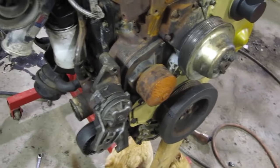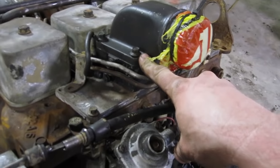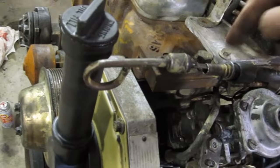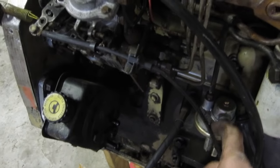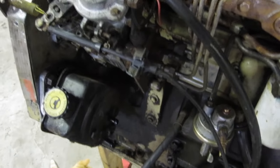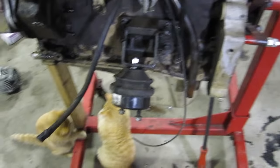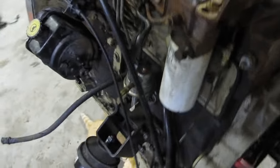I can put the AC compressor on yet. I also have the pre-heater on from the 5.9. This is the plate off the 5.9 — we just cut the end off both sides, then welded the connection tight and machined it flat so the gasket will seal properly. We're going to take our fuel pump apart and give it a little extra fuel. I also have the turbo off of the 5.9 on there, so we'll just give it a little more boost — nothing crazy.